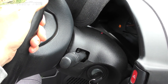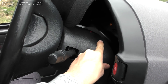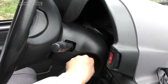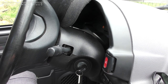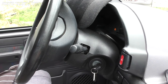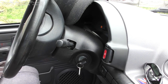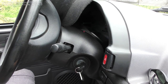I've been playing around more. A couple of things to note: the red LED seems to come on every time the key has been in the on position for a while. However, the vehicle will still start with the red LED on, and turning the vehicle off and back on will turn the red LED off for a while — it will then turn on again every single time, it seems. That is a bit of odd behavior. I'm going to have to cut that LED out because it's annoying as hell. But the vehicle seems to be starting very reliably — I haven't had a start failure yet even with the red LED on.